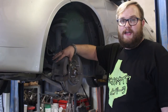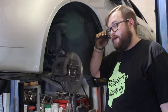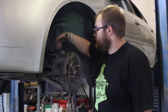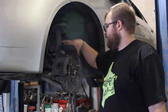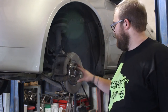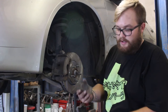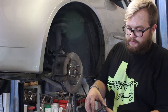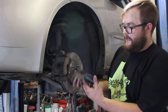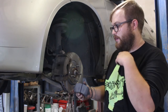We have everything bolted back together, wiped down, and tightened. Before putting the wheel back on, do a visual check — recheck all bolts for tightness, make sure everything is in position, and confirm the rotor spins freely and sits flat. Also compare your new brake pads to the old ones back-to-back and face-to-face to make sure they are the same. If there's any doubt, go back to where you bought them and double-check before continuing.